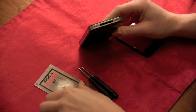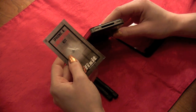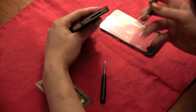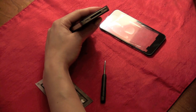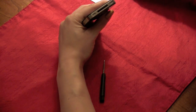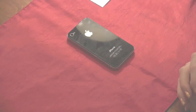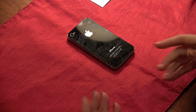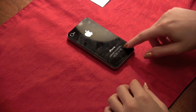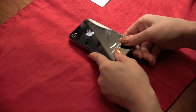Make sure not to lose them. iFixit nicely sticks them with tape on the back of the card. First, I'm going to screw out the screws on my phone. I'm going to make sure I put everything nicely away so that I don't lose anything. My screws are off and kept in a safe place. And now all you have to do to get your back plate off is to just slide it.